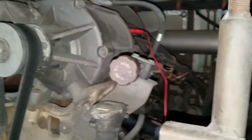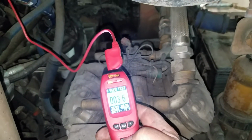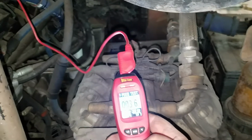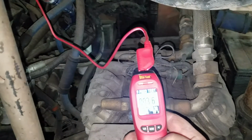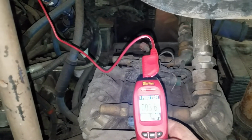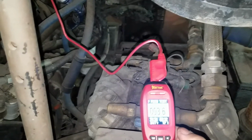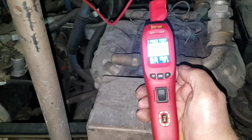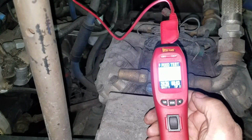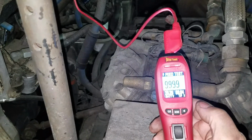Now, if you put the rocker switch forward and you put voltage to the field windings on the alternator and it charges, then your problem is either a wiring issue, or there's a problem with your regulator. I also have scope captures of these charging systems, and maybe another time I could do a screen recording and explain the operation of this system. I'll try to do that once I do get time.